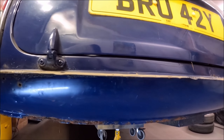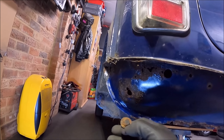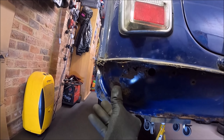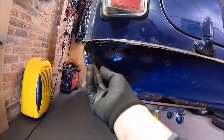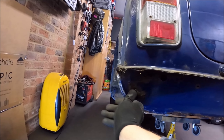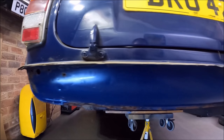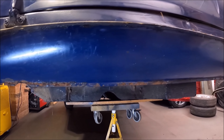There's a bit of rust on the bottom lip, but hey-ho. I notice again round here - these holes are meant to be here. This is like what we had in the sill; this is a plug they put in when they drill holes to inject wax oil. Whoever done this, there's a bit of a numpty - because like the sill, you don't need to drill a hole to get inside the sill, just go up inside the flutes. Or if you wanted to get into this cavity here, surely just take that bung out and go through there - or there's plenty of gaps in the closing panel you can go through. And obviously that hasn't fully protected that closing panel because it's going to need replacing. Let me get it all cleaned up and I'll show you the final result.